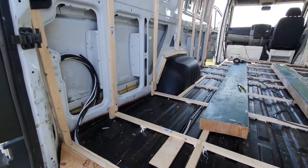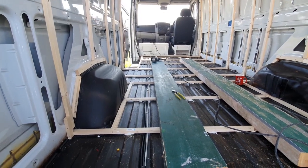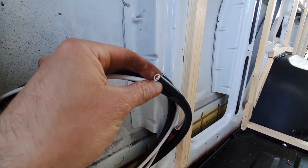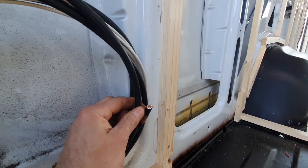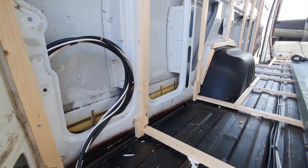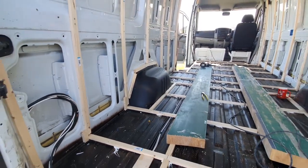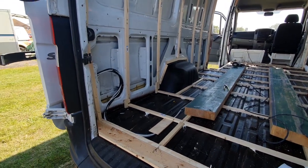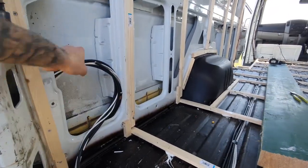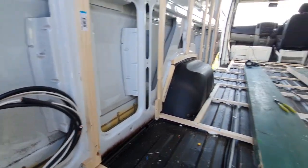What you've just been watching me do is run some cables down the length of the van from the alternator battery to the leisure battery. I've run two 25mm single-core tri-rated cables — a positive and a negative — to link the two batteries together. I'll put a split charge relay between them so the alternator will charge the leisure battery when the alternator battery is full, and solar panels and the battery charger will charge the alternator battery if the leisure battery is full. I've also run some two-core 1mm cables just in case I need anything down the other end later on.